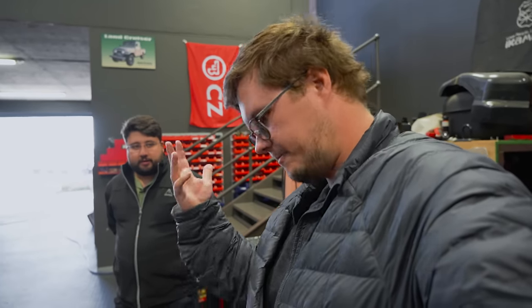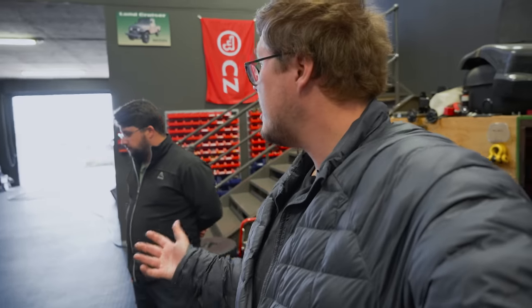Terrain Tamer also have a 1-ton parabolic leaf spring, which we can try out as well if the build gets a bit too heavy. But the goal is to work with something that is pretty standard across the board. A lot of the trucks are going to the 500 to 700s and getting great results. I mean, my Hilux was seriously loaded on a Namibia trip. We had extra water, I had three people in the vehicle, diesel, spare wheels, everything.